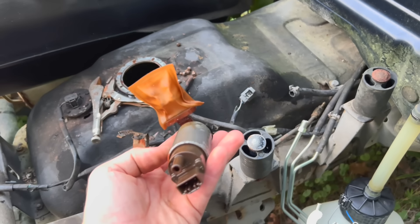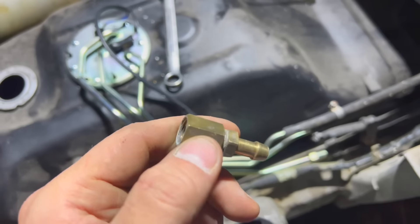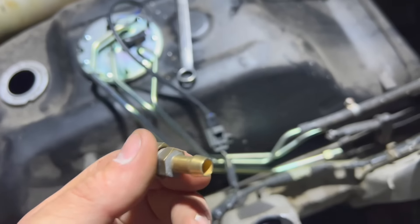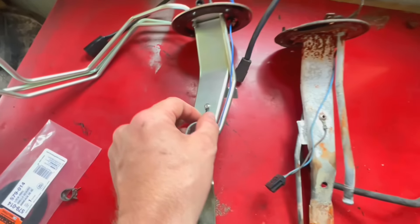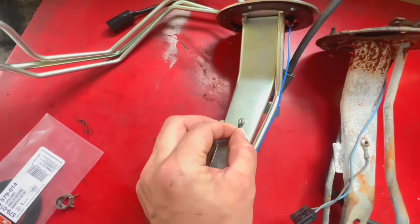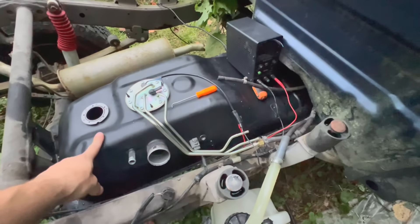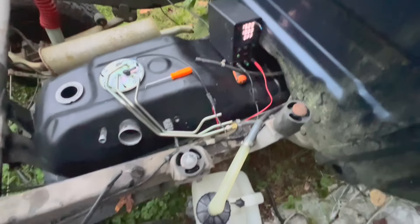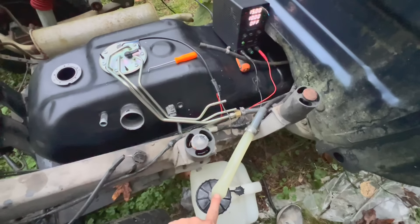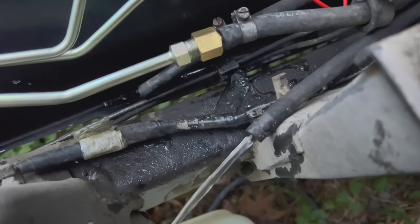It ain't great but it's a lot better than it was. I'm gonna slap that into this hanger right here, pop that into the new tank, and see if it'll fire. The new gas tank hanger does not come with this adapter piece, so make sure you do not throw that away with the old one like I almost did. Last time I tried running it there was a bunch of water in the tank, so now that's probably all throughout the fuel system. I'm going to run the pump with this power supply until I get pure gasoline coming back up the return line, then connect everything up.